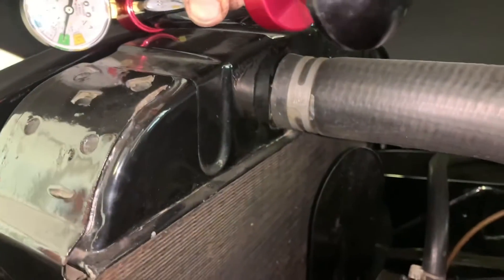All right, we got coolant out of there. Bill's Packard — where's that leaking from? It's dripping on something. I'm gonna crawl under there and look. It's seeping on all these core plugs, it's a little wet here. How much pressure do we have? It's already dropped down to six and a half. Let me crawl underneath. I hear it dripping.